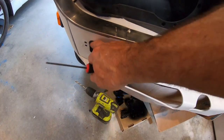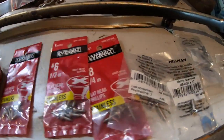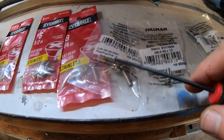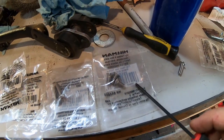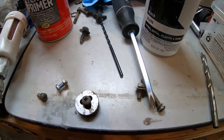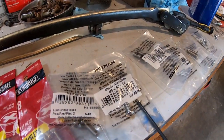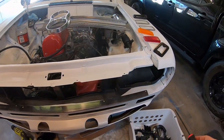I may do the two on the turn signals as well to get rid of all those little clip things, because they just scratch the paint. Here's what I bought: five by 0.80 by twelve millimeter bolts in different sizes, and also some for the interior — sun visors and rearview mirror, all the same size. I also figured out that five by 0.8 is basically the same as 10 by 32 according to my tap gauge, and I've got tons of five by 0.8 bolts, so I just bought a whole bunch more.